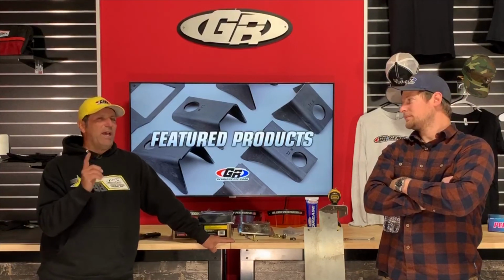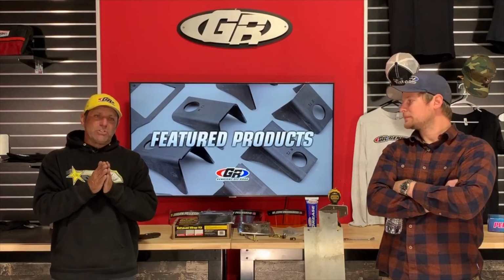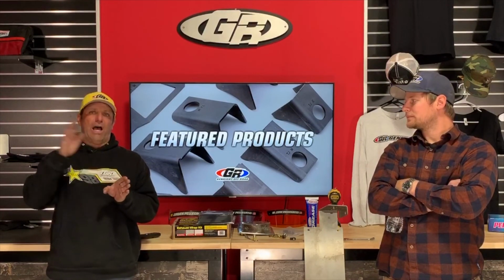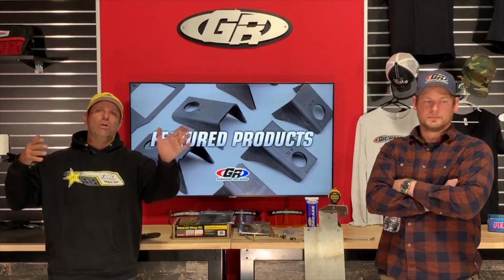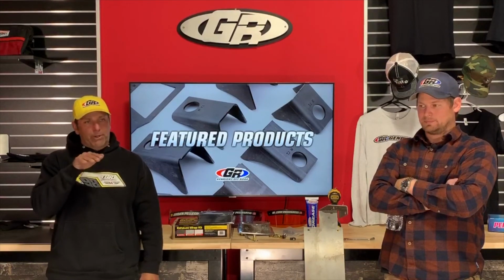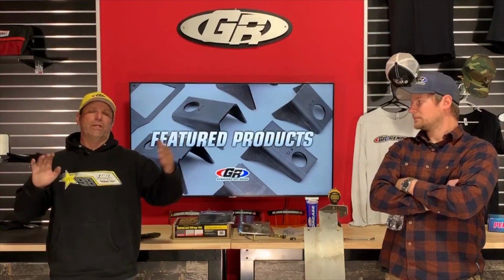KOH. Okay, so Kevin Sakalis used to run a manual transmission, but here's the problem. When you go through the whoop-de-doos, and this is another part of the reason that I run the high stall, the high stall torque converter helps to cushion the driveline as you're beating through the whoop-de-doos and the rocks. And remember, guys, we're not just bopping along at quarter throttle. You're on the gas.